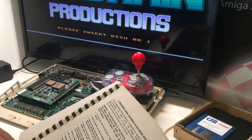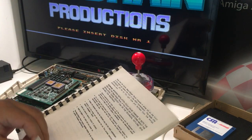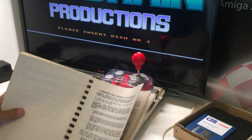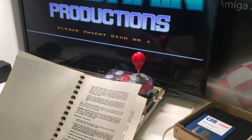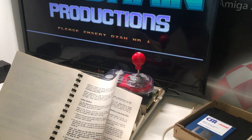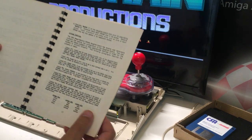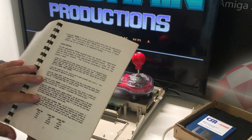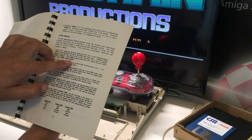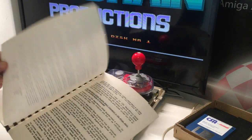How do I install it in the Amiga 500? Could be a good idea if I read this first! But I'm the kind of guy that never reads manuals — I just do it, plug and play. So many warnings here. 32-bit DRAM — how fast the RAMs are! You can fit 256KX4 DRAM or 1MX4 DRAM, so you can have two different RAM models.